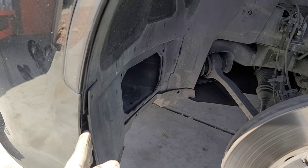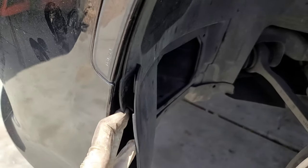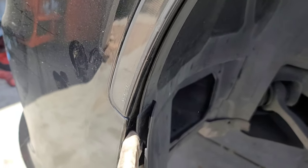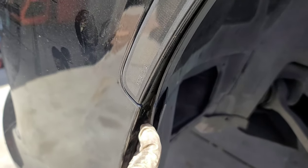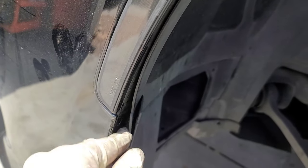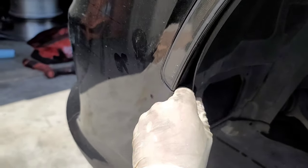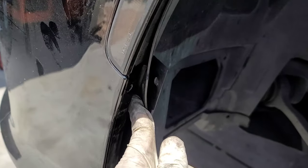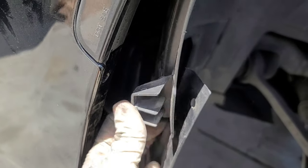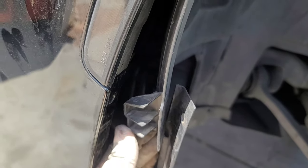Something that I forgot to mention is that when you remove these clips, there is going to be a little section here on the side by the side marker that is going to be a little bit stuck on there. All you got to do is push it towards, I guess, the inner part of the wheel well. So push in and then go ahead and wiggle this guy out. And what it is here is just a little plastic tab that grabs onto the inner part